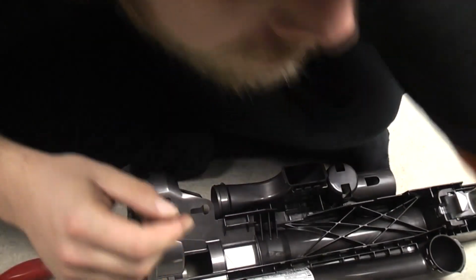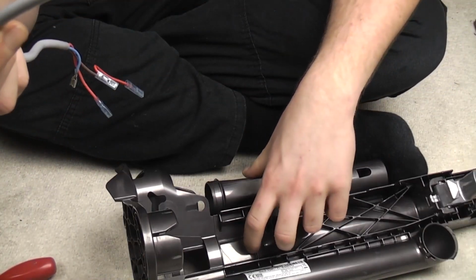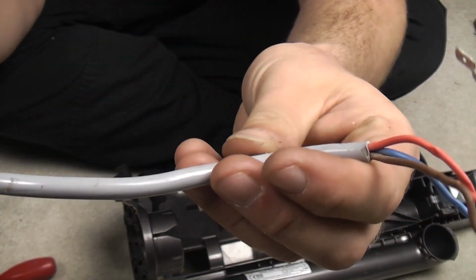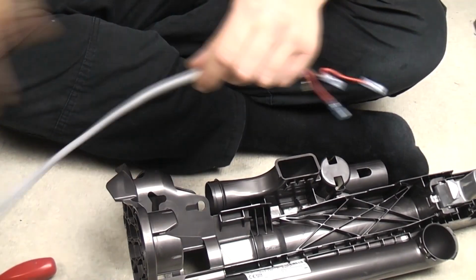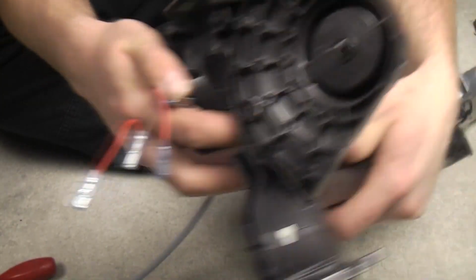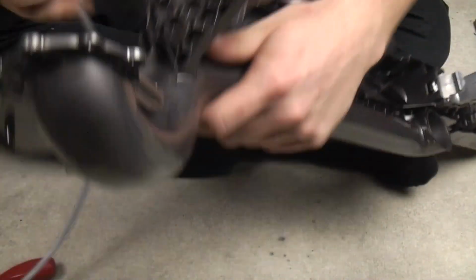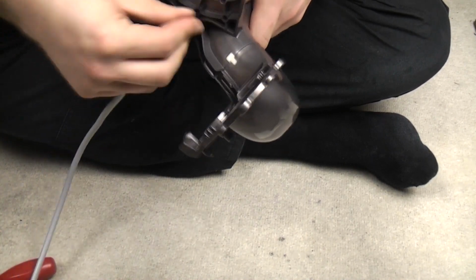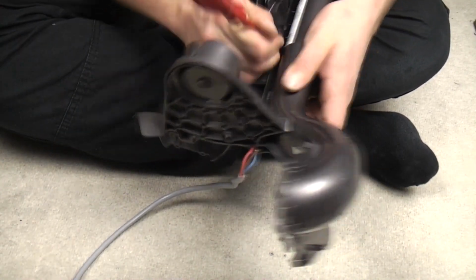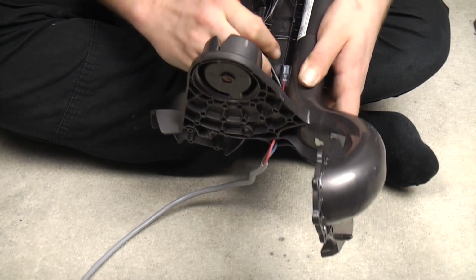Because it is time, and I'm not going to pull the parts out now, because we need to use them all for the main show. And the first thing to do is to put the spinal cable back in place. Now this isn't as tricky as it sounds, mainly because you can follow the marks from where it was before. So we need to go from there all the way down there, and then behind, out of there and up there. So to start with, you need to feed the connectors through the hole one by one, because they'll bind up if you try and force them through. But once you pull the first one through, the rest do sort of follow.